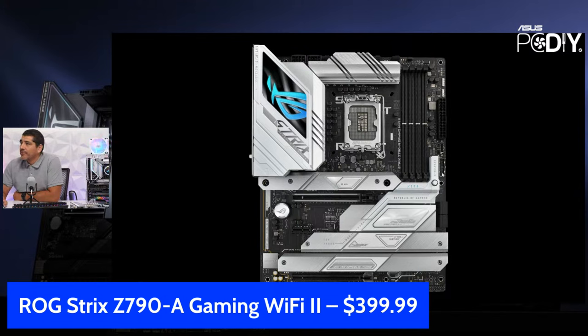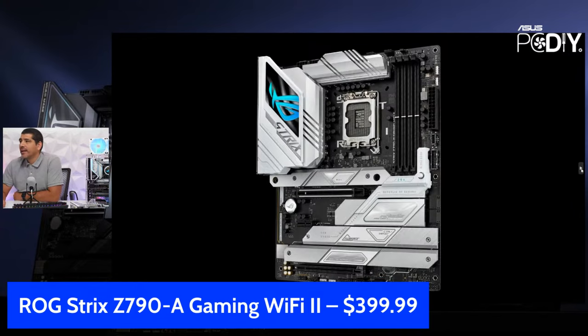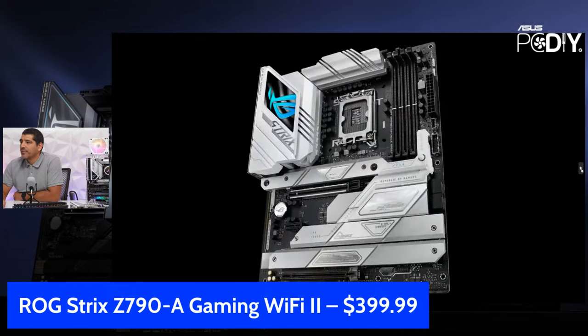You have the reinforced USB 3 header, you have the USB-C header as well there, and you can see you've got four M.2 SSDs, all with their own, of course, dedicated heat sinks as well, and that really nice, cool, clean, bold ID design that we have on, of course, our ROG Strix boards, right?